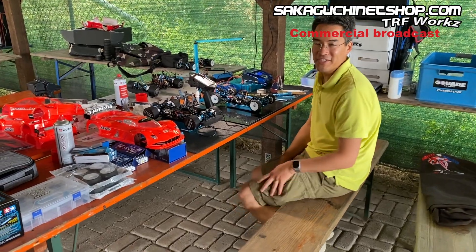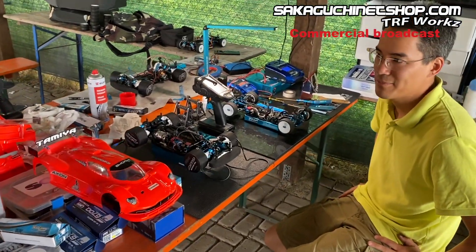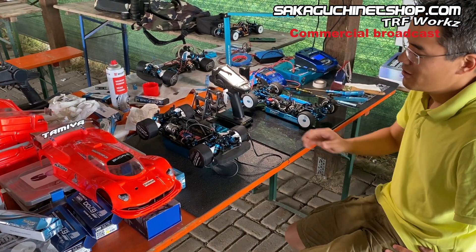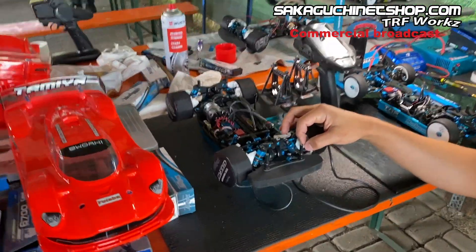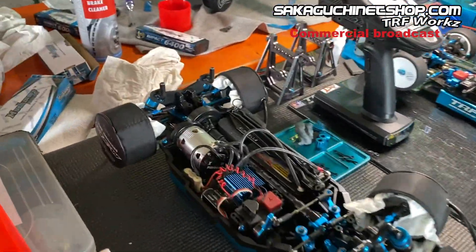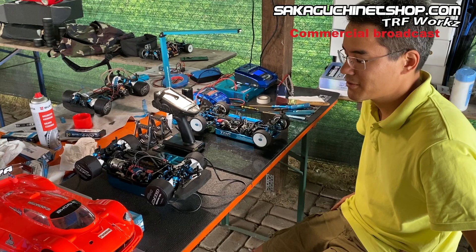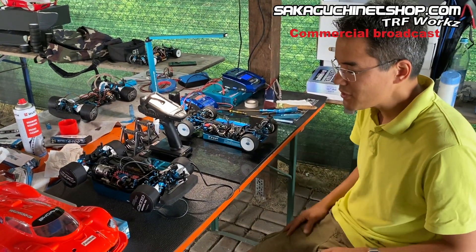Hello from the racetrack here in Vesnesbach. I thought it's better to say some words from the racetrack directly instead of being in a boring room. This is my TT just on a race setup on the tire heater, so we are going to observe some laps soon. What I wanted to mention is I changed the springs in the meantime to the long Tamiya big bore springs — no marking in the front and red markings in the rear, which is medium on the rear. They drive pretty well on this car.